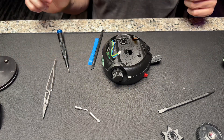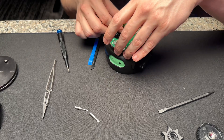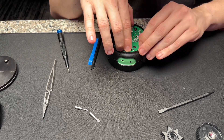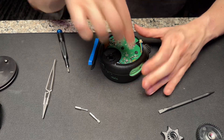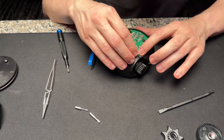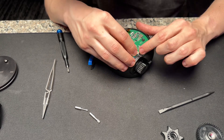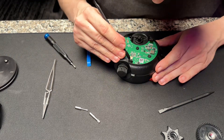This electronic panel needs to go with my old one — actually the new one that's broken. This is the tricky part because you have to align these pins exactly on top of the pins in the connector and then push down on it. You should feel the pins come through with your finger. Make sure this cable is not getting pinched, then it sits all the way down. Apply the power cable for the motor back — I may have broken the tab on this connector, so this side tab is kind of broken, but it should still click back because the connection is made with the metal clips. That's why you have to be super careful.